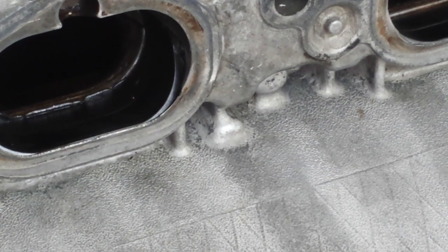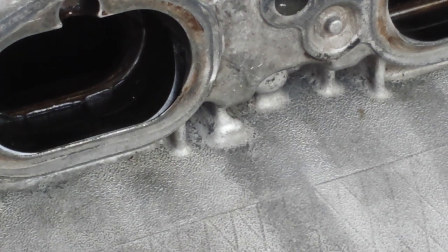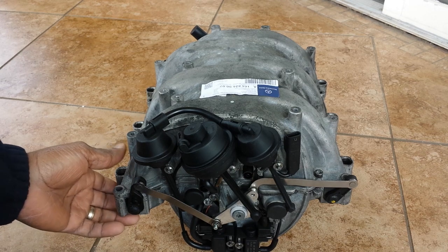And this problem is caused by the air flap inside the Mercedes-Benz intake manifold breaking, causing unexpected and supremely deficient performance depending on the orientation of the flap that has broken. These flaps getting gummed up and then sticky, and then the weakest part in the system breaks.